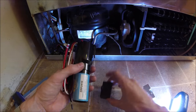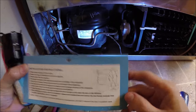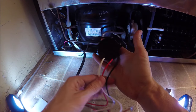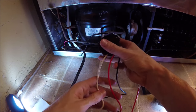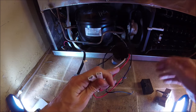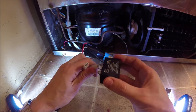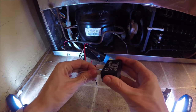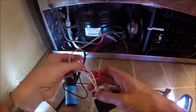We're going to keep our capacitor. There's actually a little diagram that comes with the new one. We'll unravel the cords — there's going to be a white one, red one, and a black one on one side, and two black ones on the other side. The red one and the white one have a couple of little connectors that we're going to plug into our capacitor leads — the male ends into the female ends. It doesn't matter which one goes to which lead. These are kind of daisy-chained wires.